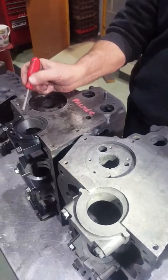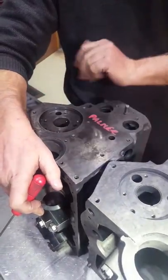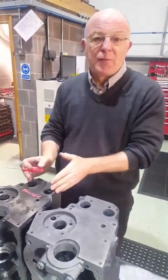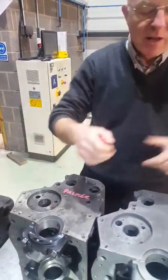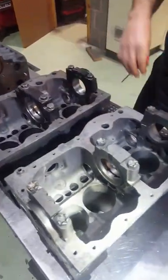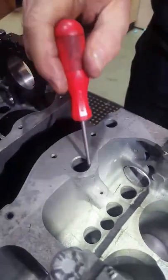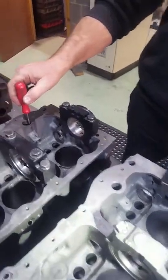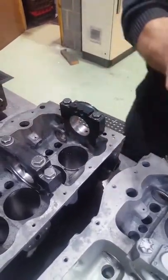Also, there are one, two, three holes here — this one hasn't got it on. What there is, is a little horseshoe that fits there which has the scroll seal. That's been taken off this block for a reason I'll go through later. These midget blocks are getting really scarce — 1275 inline. So what can you do? What we're doing is, if we're desperate for one, we convert one of these mini blocks. We set it up on the mill, dial in, put the dowels in, drill the extra holes. And you can convert a mini block to a midget.